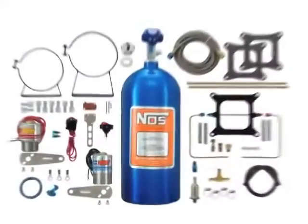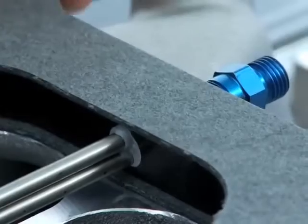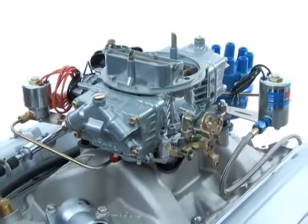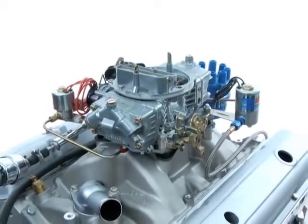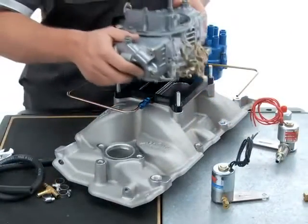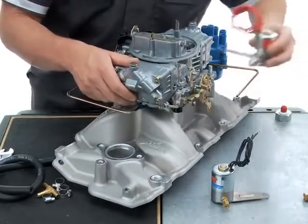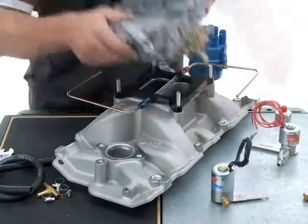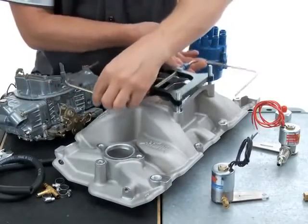For a plate system, there will be a specifically designed install orientation for the injector plate. The placement of the solenoids, however, may depend upon the area of the engine that you intend to pull the additional fuel from. If the additional fuel supply for the fuel solenoid will come from the driver's side of the engine, install your plate to orient the fuel solenoid to that side.